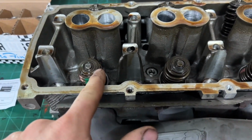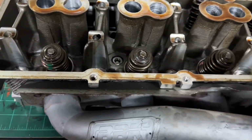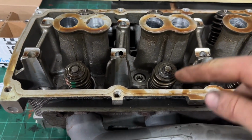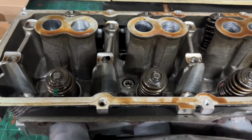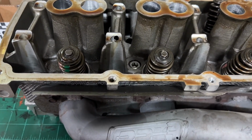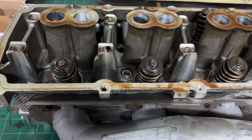Okay, so first things first, you need to separate the seal from the retainer from the lock. So you tap lightly on these with a hammer. Make sure you don't use a steel hammer. Use something rubber, plastic, whatever you got that's not steel. You gotta be careful because you can bend the valve. So you're listening for an audible change once it releases. That's really high pitch when you first hit it, and then it'll be more of a thud noise once it is released. So once you get the thud, you should be good to go.